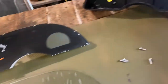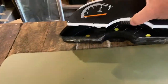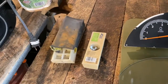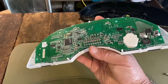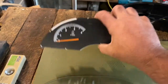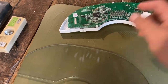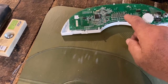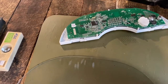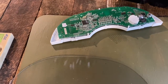What I found was it did have some water inside this casing. This unit sits inside this casing, so there was a little bit of water in there. I pulled this out and said, man, that looks expensive — I hope I don't gotta change this. Anyway, the pins had some corrosion on them, so I said maybe that's the problem. I took a little sandpaper and got the corrosion off, plugged it in, and the lights came on. I turned the key off, turned the key again — lights came on. Turned the key off, turned the key again — it didn't come on again.